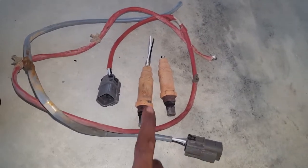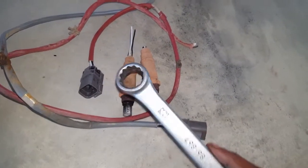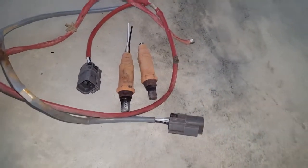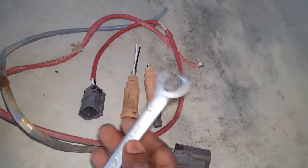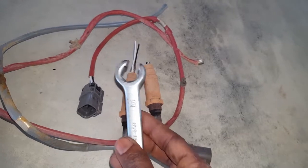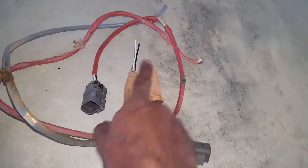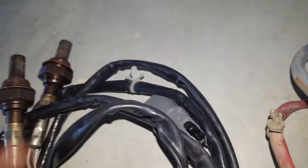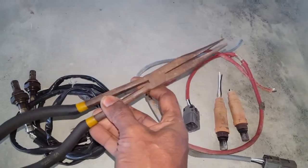To remove these oxygen sensors, we have to cut the wire to install our box end of the 22mm combination wrench. It is always best to use a 22mm line wrench for removing these oxygen sensors without cutting the harness wire. You will notice fixed to the wiring harness are various plastic retainer clips. These clips are going to require removal and you're going to need needle nose pliers.